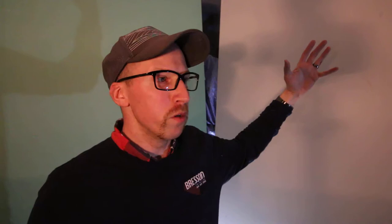I don't want to tell you that you shouldn't do it. What you should do though is spray in your garage. Keep your garage door open and vent everything out for a little bit. If you've got a window in your garage, open that too, get a little cross breeze, and then close it up. Make sure you use a leaf blower or something to blow everything out of your garage before you start your project. Keeping debris away from your project is key. I cannot stress that enough. Keeping contaminants away is going to give you that pro finish you're after.